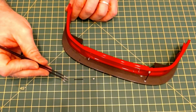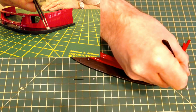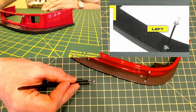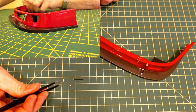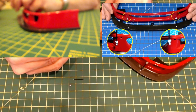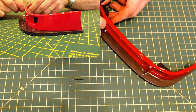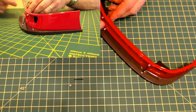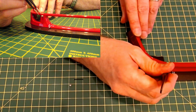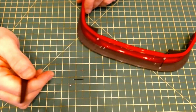Also, in my previous video I mentioned that there's a left and right, and it all depended on this little bolt on the side, which had to go to the outside. That's because the picture in the magazine, and I'll put a picture up in the video, shows that bolt going to the outside, but I don't think it's actually that. I think when you watch the how-to video and a few others, it's all to do with the top mount of the tie rod, making sure you get the right one into the right hole at the top. It needs to fit flush in the top of the body, and the bolt, if you like, is to the inside, not the outside, and that fits flush. So I probably had them on the wrong side as well, so I was putting too much force on.